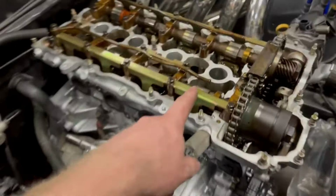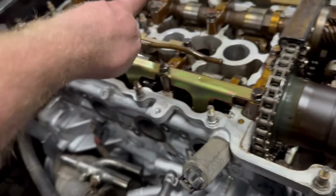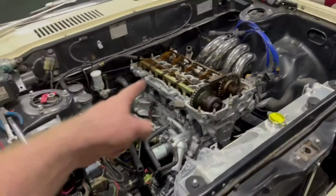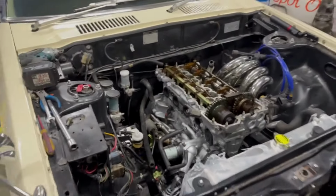And I want to, like I said earlier, or maybe it was in the last video, check and make sure all of the oil squirters are working up here. Before we go any further with it, need to make sure we've got oil pressure. We don't want to have another RB30 incident where we spend 3 days trying to get oil pressure. So yeah, once I do that, then we can finally get the rocker cover back on and start buttoning some of this up, because we're getting very close to actually starting this bad boy. Obviously we need to do some wiring and stuff, but we'll sort that out next video.